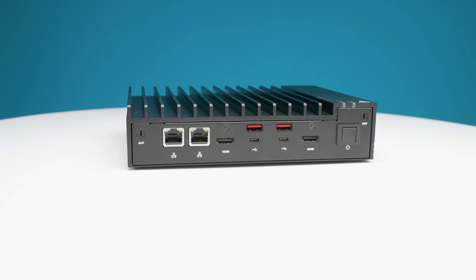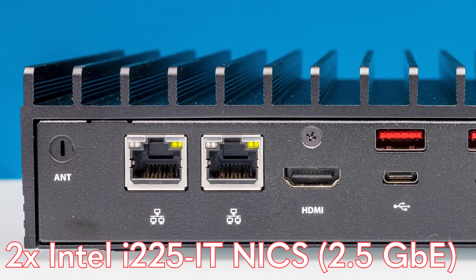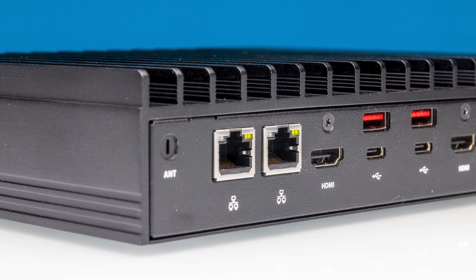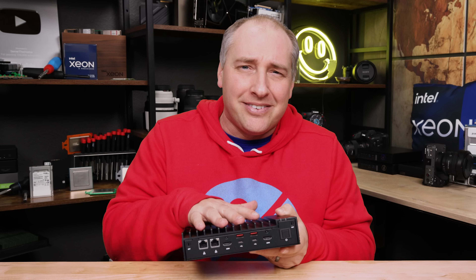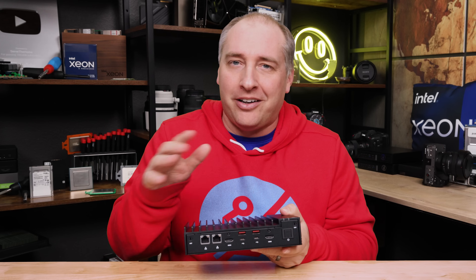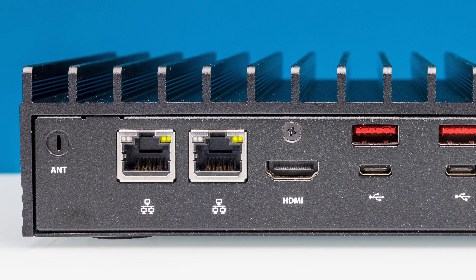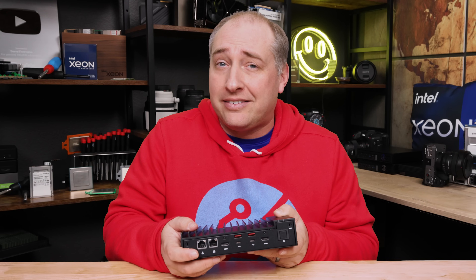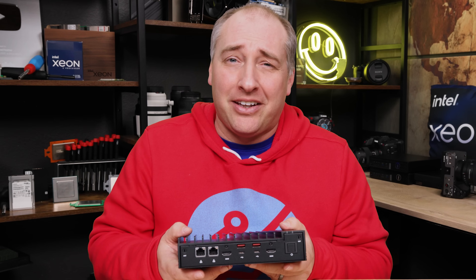On this side of the system, you're going to see two Intel i225-iT NICs. You might be wondering what the iT variant is versus something like the Intel i225-V, which you'd typically see in a desktop. The iT is the version of the NIC designed for industrial-grade temperatures and conditions - it's really made for being deployed out in the field where it's going to get some grime on it. Both of these NIC ports are 2.5 gigabit Ethernet, which is pretty good.